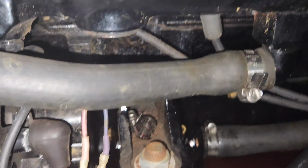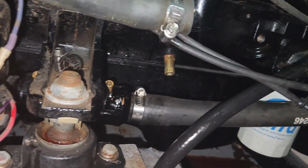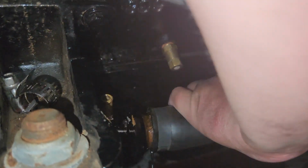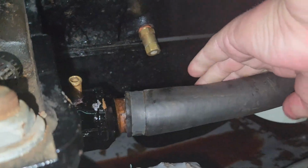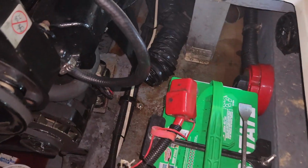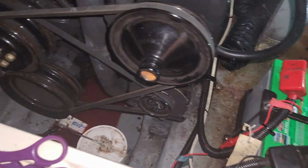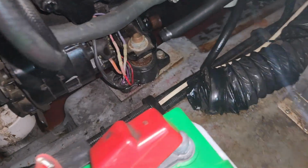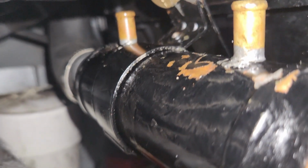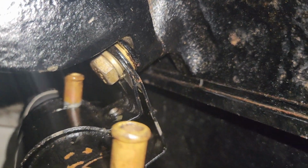So I successfully removed the line on the other side of the power steering cooler. My camera is just coated in power steering fluid right now. And by camera, I mean my phone. Here we go. There's your water supply, I believe. All right, folks, I'm slowly losing my mind. It turns out that the strap that is holding on the power steering cooler is actually integrated into the engine mount. So there's the strap. The strap goes up, and there's the bolt to get the strap out.